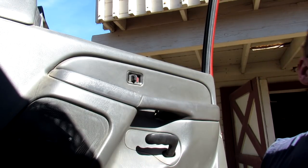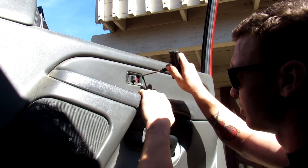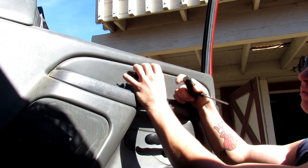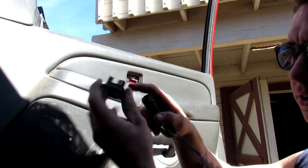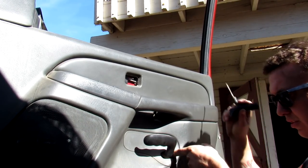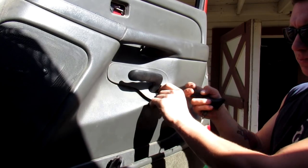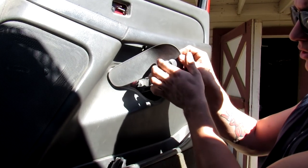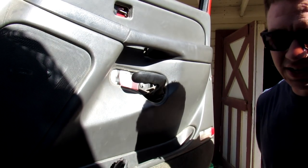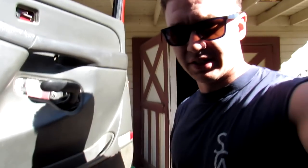We're basically gonna go over everything. I'm using this little tire poker thing — kind of whatever works — just something that you're not gonna completely destroy the trim with. Pop out the lock from the backside, it comes out a lot easier. There's a little lock tab on this one that pops right out. Next you're gonna reach your finger right in here and pull the back side of this out. Open the door handle and slide it off, so that takes out this piece — super simple.